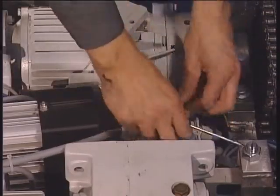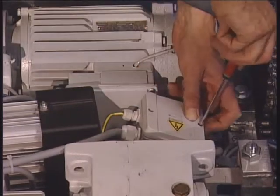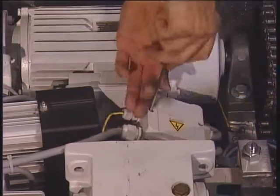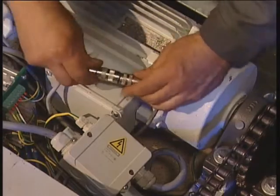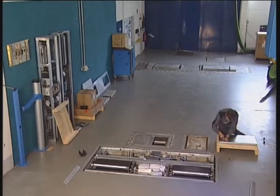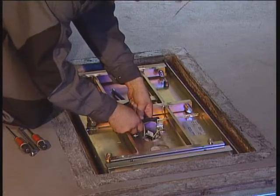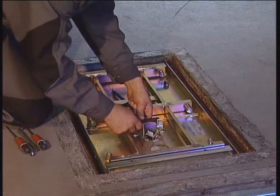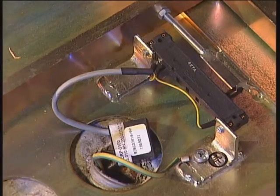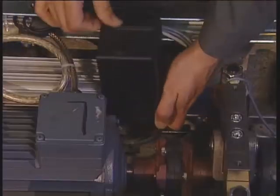Since all motors and sensors are connected by the manufacturer, the installation will be completed when the motor cable has been connected. The pedal force sensor can be added at any time and needs to be plugged in only. The ST600 side slip tester will be laid into the pit bed as the last part of the test track and aligned. After the track sensor has been assembled, it will be connected with the field bus system.